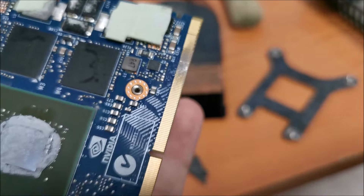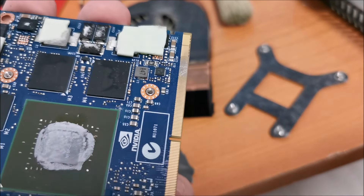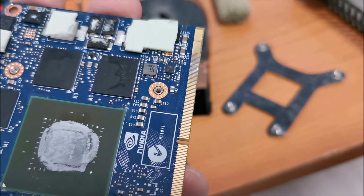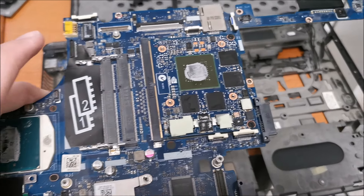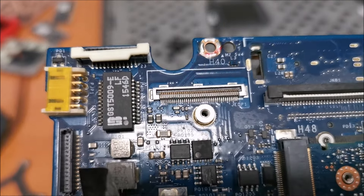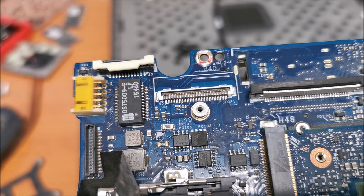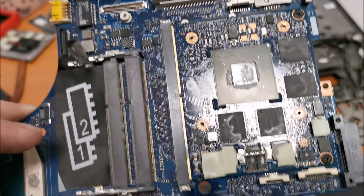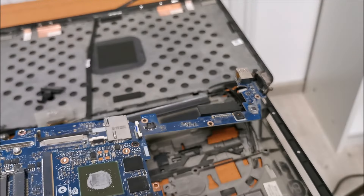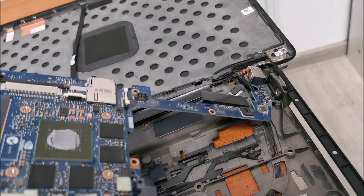Needed to clean the traces with 1800 or 1600 grit sandpaper — really, really fine. And now we don't have corrosion, but we do have a bit of the pads missing — they were damaged by corrosion. But hopefully they still conduct. Clean this up and also clean the connection that this goes into on the motherboard. Starting to put everything back in place — put in the GPU, clean this area. You can still see where corrosion was. But nothing is shorting anymore, at least I think.